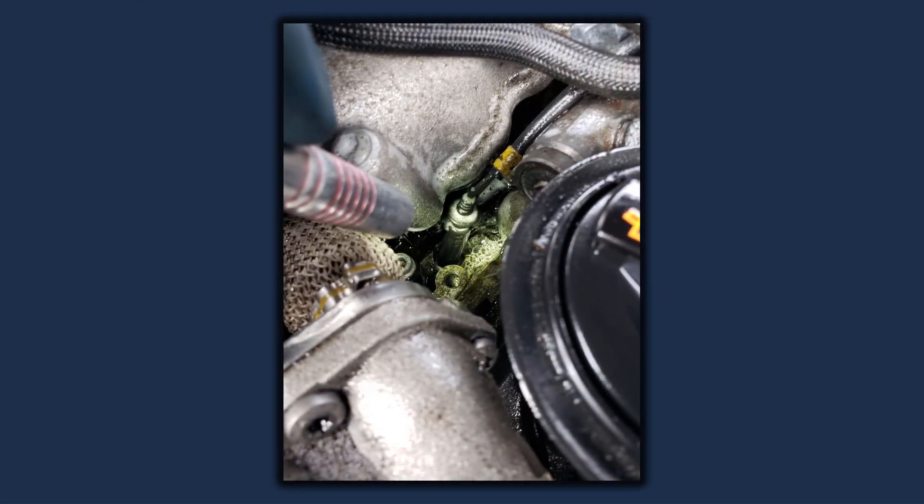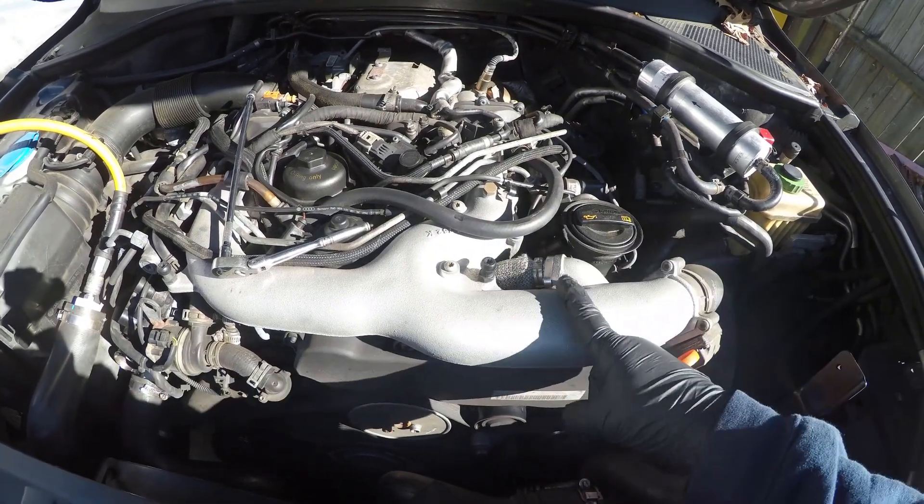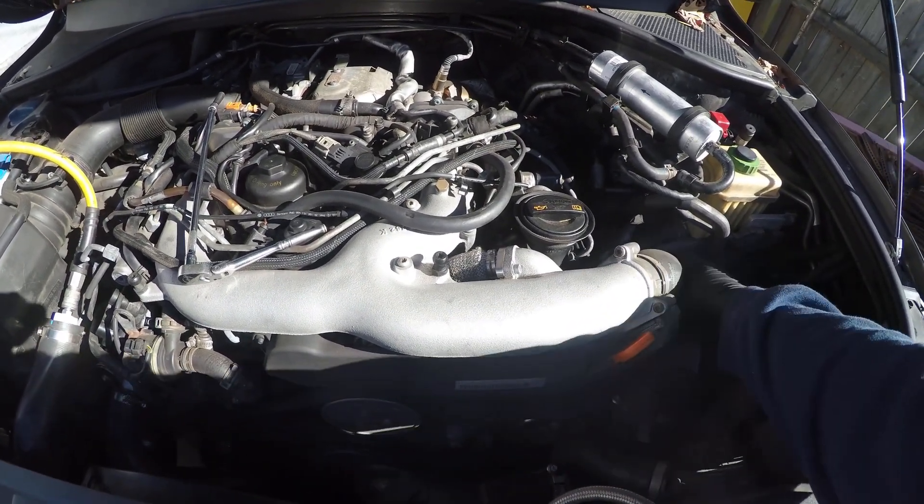This picture is from the shop Q7 — it's a 2012 CATA engine that had a major leak from the lower intake manifold on the driver's side, bank two. The gasket between the lower intake manifold and the cylinder head was leaking. It caused a couple of issues — some weird driving parameters, cruise control wouldn't work correctly, and it wouldn't get the fuel economy we wanted. I applied air pressure and sprayed soapy water using Spray Nine chemical to see air bubbles escaping. This was just an easy visual to show air was escaping with the boost leak testers.